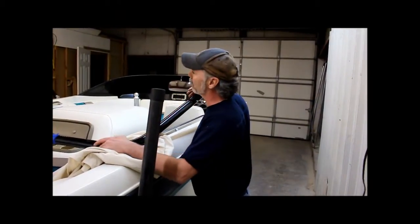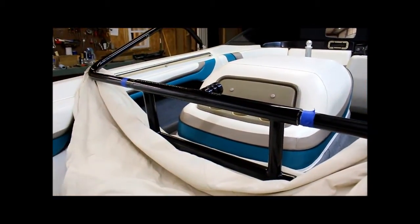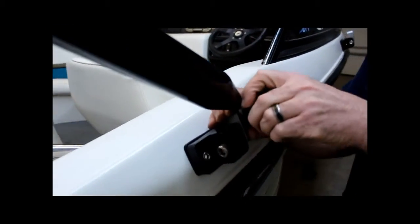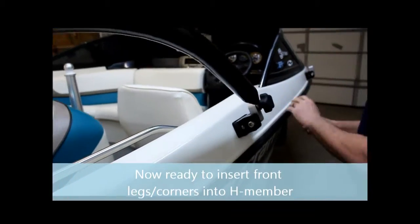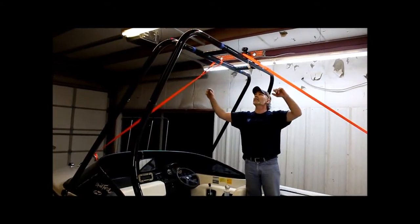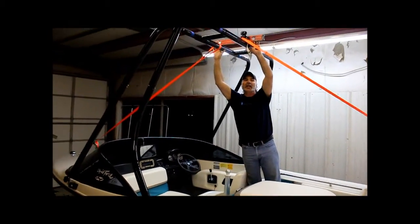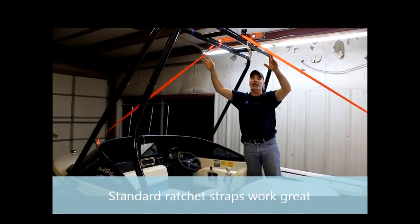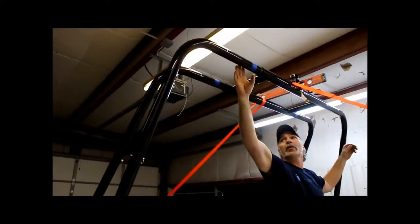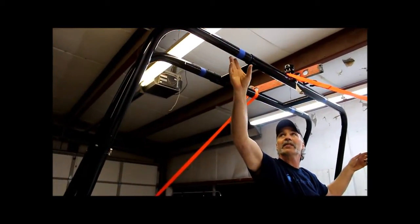We've got this bigger H2O on the boat. We've got the back leg stabbed into the H-member, and then we came up here and attached the legs to the quick releases — love the quick releases. Now we'll stand it all up and stab the front legs into the H-member. We've stood the tower up, and this is the point where we put the straps on it, running one to the front of the boat and one to the back, just close to level as a good starting point. Our tape kept us from sliding in too far and scratching up the corners — if you go in past where you want it and then come back out, they're going to be scratched. So the tape stops that from happening.